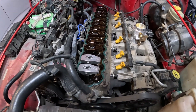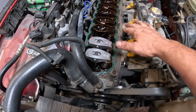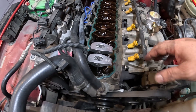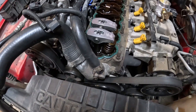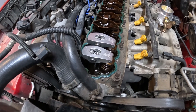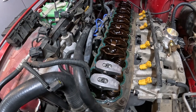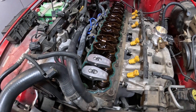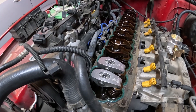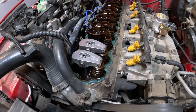I just wanted to show y'all what I've got going on here. I've got the valve cover off and I'm going through basically turning the motor over until both the intake and the exhaust are on the base circle, then I remove that set and bolt on the new set. These are the Scorpion 1.7 to 1 ratio rockers and these will clear the factory valve cover, or at least so they say in their documentation. We go through one at a time and they work with the factory push rod, which I think is kind of neat — and I actually tested that.